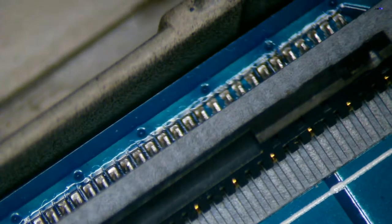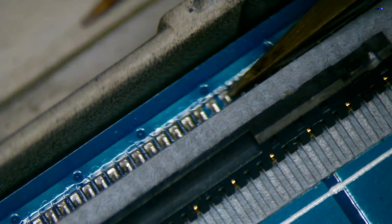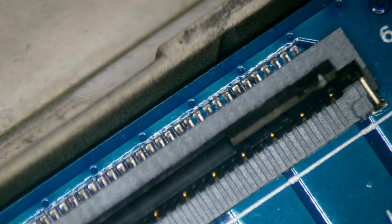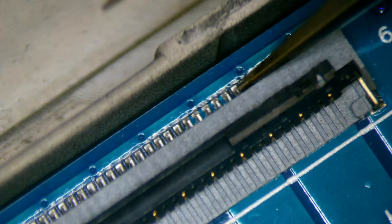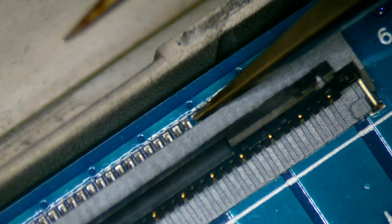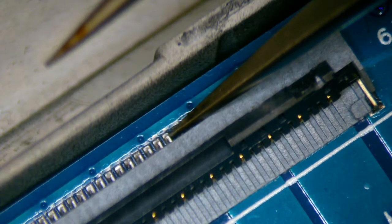There were some forums on the Lenovo website where people described having a hard drive problem. But we didn't really notice the true cause until we took a look under the microscope. As you can see here, the solder joints where the pins are — they're very, very loose. I should not be able to move this that easily. It should be very stiff and well done. There shouldn't be any movement on a solder joint, especially for the pins going to the hard drive. Because the solder joints are bad, the cable doesn't really mean anything — it's not connecting to anything if the solder joints are loose.